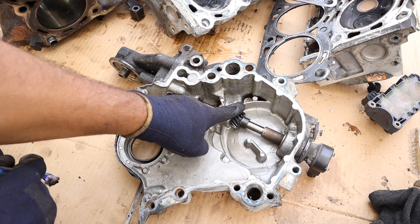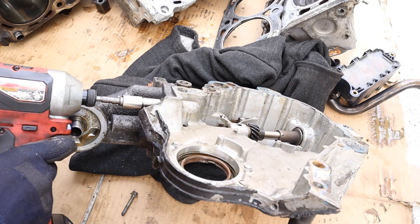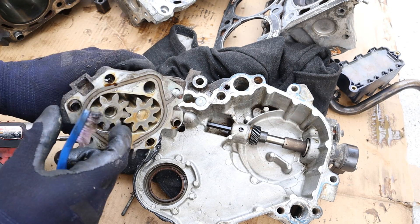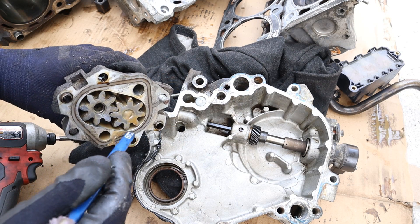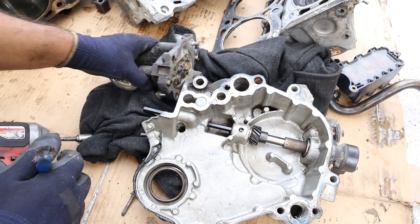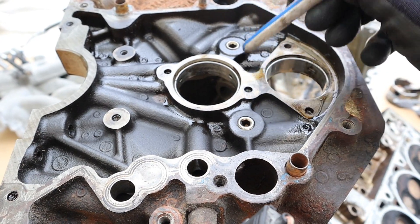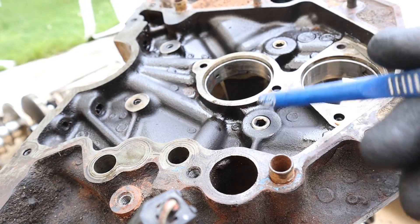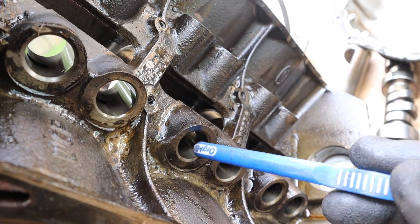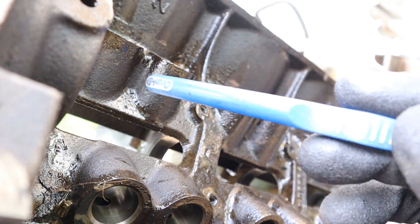This gear, which was driven by the gear behind the camshaft, is what actually drives the oil pump. Let's take this thing apart real quick. It was an 8mm and now I had to change to a 10mm — I don't like how Ford is using different fasteners for the same part. You can see it's a gear style oil pump with a lot of that milkshake material inside. As this rotates, the oil is going to come in and be squeezed into these gears which generates that oil flow. The shaft has a helical gear that interfaces with the one on the camshaft to drive all of this. That filtered oil then comes in over here and is sent down to the front crank bearing to power the two oil galleys that run the length of the block. There's also a small galley that lubricates the front cam bearing, and those oil galleys also run right through the lifter setup where the push rods plug in, so those get lubricated as they move up and down. The camshaft bearings also tap off this oil galley running the length of the engine on both sides.